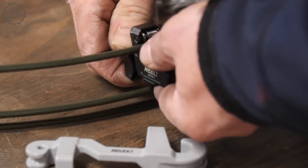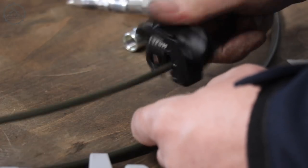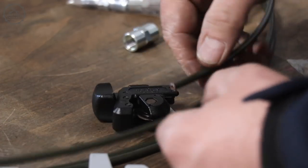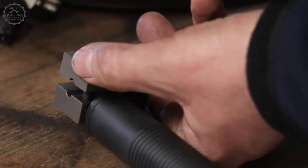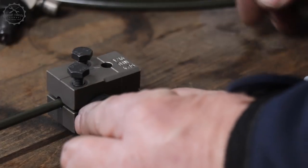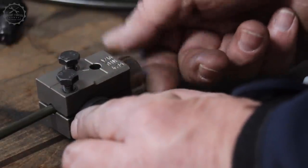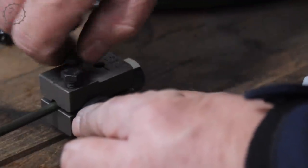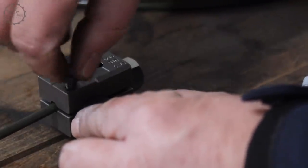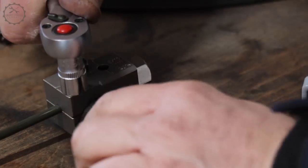If you want to make your own brake lines, there are cheap and reliable tools available everywhere on the web. You only need the lines, the fittings, a cutter, a bending tool, and the actual flaring tool. It's so easy, reliable, and such a satisfying work. Sometimes I have the choice between going out with girls or doing some flaring, and I hardly ever opt for the girls. The basic concept is to firmly clamp the line into the tool and then do some cold forming with a stamp that is pressed against the line.